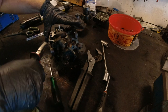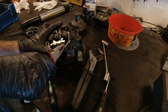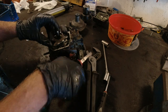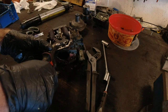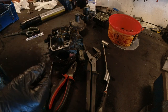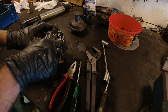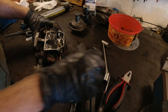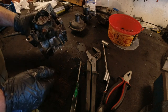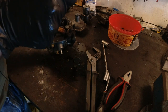It seems to go one way - it just pops out. Honestly, if you have carbs on your car and you've never taken them apart, I recommend getting a spare set and exploring them. It's really the best way. Yes, you can read a manual and watch videos, but taking them apart and exploring is the way to learn. There is the needle and seat - that didn't come in the kit and they were pretty expensive, so since this one was working we're just going to clean it out and it should be fine.